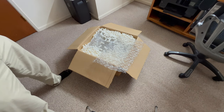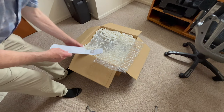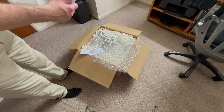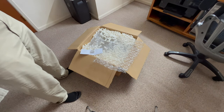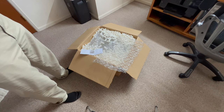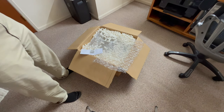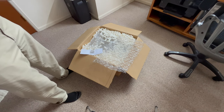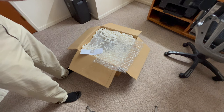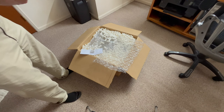Garth is a very, very kind individual. He sent me a plug and also an SD card. The note says: 'A few things I wanted to point out with this LC. Since it does not have a battery, it will boot with the settings as default. That includes the color set to black and white, mouse speed set slow, 32-bit memory addressing disabled, disk cache set to minimum, startup disk not set, and of course date and time reset. You'll still need to fix those settings on every cold boot if there's no battery present. That will thank you in the long run on a system like this.'